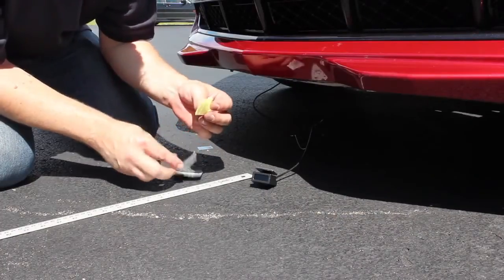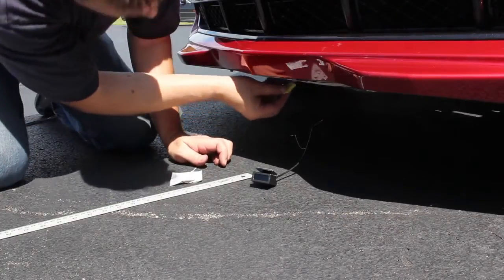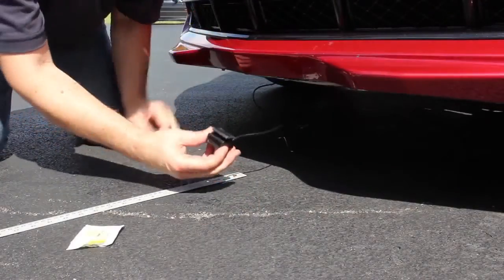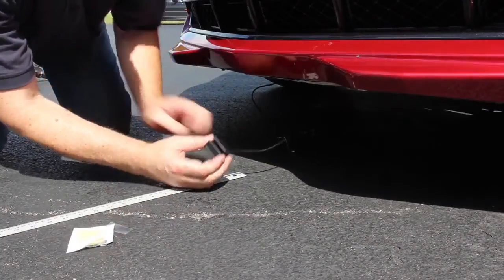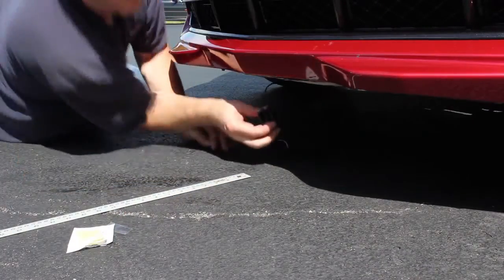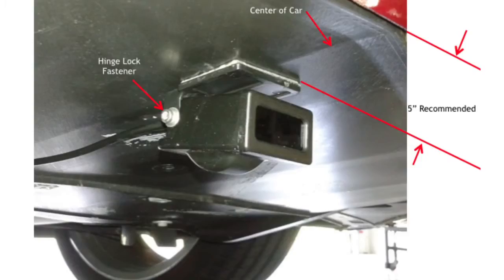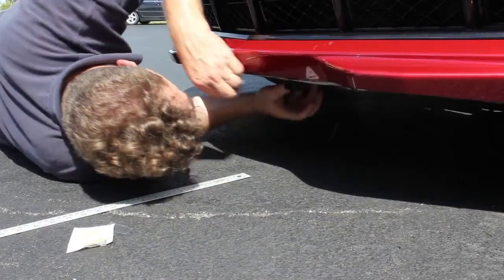Using the supplied 3M adhesive promoter, wipe generously on the underside of the car where the sensor will mount and along where the cable ties will run to the square opening. Mount the sensor by peeling and sticking to the area shown — notice the dimension of five inches from the front of the vehicle. This distance works well in testing with the Stingray, hiding the sensor from view while still allowing maximum alert distance. Loosen the hinge fastener with the provided allen wrench just enough to allow the sensor to pivot up to run approximately parallel to the ground.